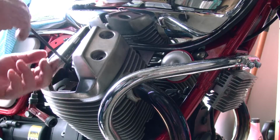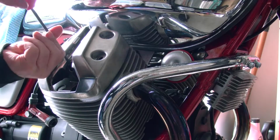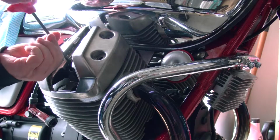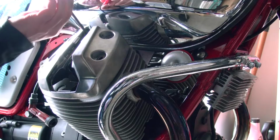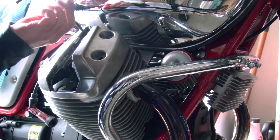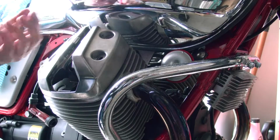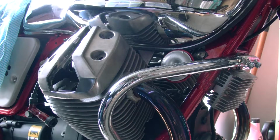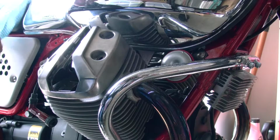And the first tighten that you want to do is not really a tighten, you just want to get the bolts in there. You get them all in there first, and then you do this diagonal thing because you want the pressure on the gasket to be the same across it. You don't want leakage. Okay, so yeah, just a little bit down, and then get the other main bolts, give them a bit of a wipe.